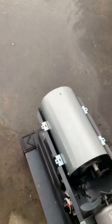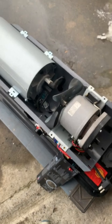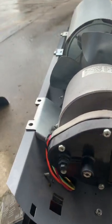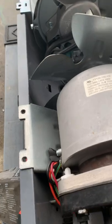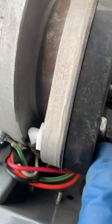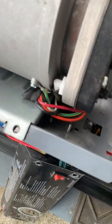Same exact result — fuel still spitting out the front. I tried to adjust the airflow here and it still didn't make a difference. I gave it a once-over thinking, what the heck is going on? Then while I was looking at it I happened to look over the top here and noticed there's another hose. This one is for air and it sends the right amount of air through there.